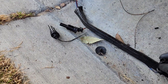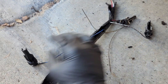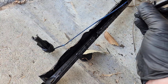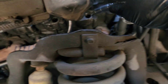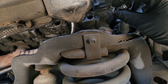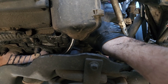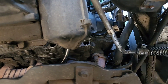Here's what this looks like, and man, it is filthy. You can see the damage I did — I don't think that's supposed to be necessary — and I broke some of these. Grab yourself a deep well 10 millimeter, so you're probably going to borrow one from somebody because yours is missing, and stick it down in there. I have to put an adapter on it sometimes to get enough leverage — drop it down in there, break it loose, and then take it up. Throw a little adapter on there to get a little more meat on it so you can turn it.